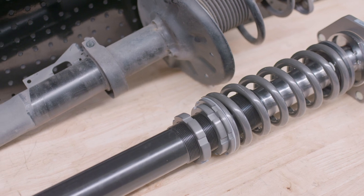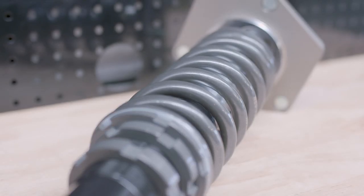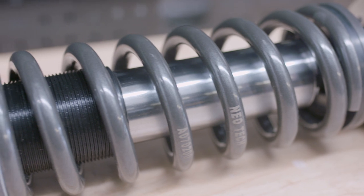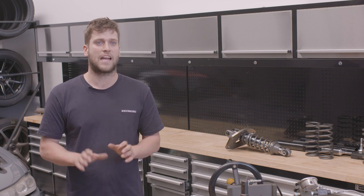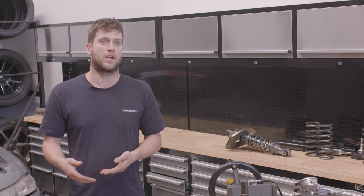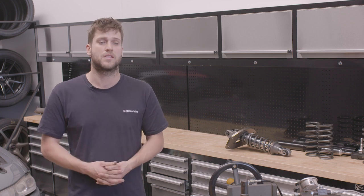One thing I'd recommend — especially if the coilover spring rates are heavier than normal — is to always run zero spring preload. For example, on a Silvia with a 7kg/mm front and 5kg/mm rear, you don't need to run spring preload. Unless you have a very short stroke damper, you don't need to preload the spring to make it work. The spring is a linear rate; it doesn't change. Only when going to lighter rates or using helper springs do you need to start playing with preload.